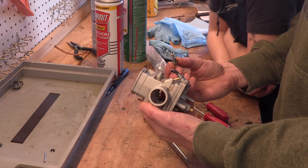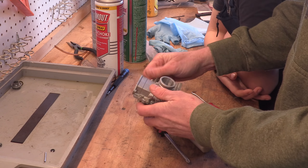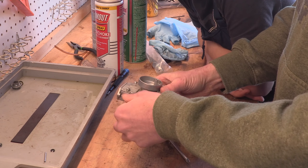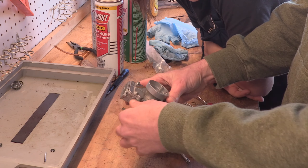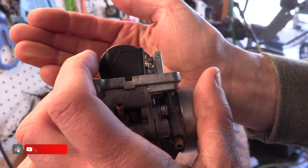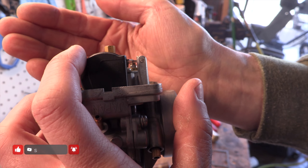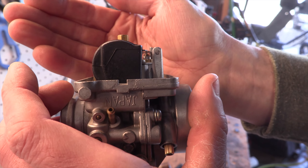Now this is for your idle. The slide on your bike is pretty worn out, so this has to go all the way in — we should replace the slide eventually. The manual says these guys need to be even, and looking at the valve it is just touching it. It's depressed all the way in and it's supposed to just be touching slightly, and it looks even to me, so we're going to go with it.